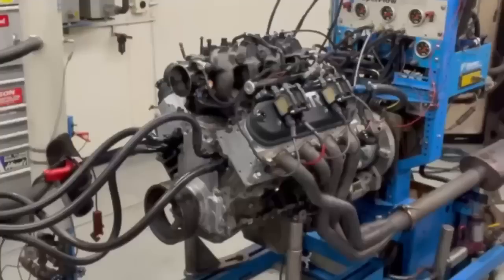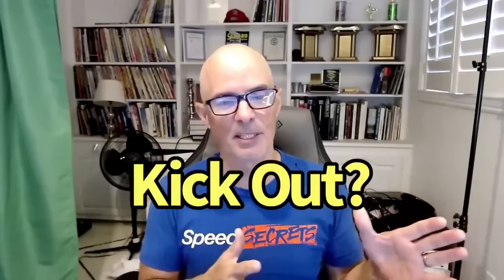When we ran this motor and made 476 horsepower, we ran it with a truck oil pan, which is not ideal — it's what the motor came with. It already has a windage tray, which is definitely beneficial. Two things that would help: one is a better oil pan, something maybe with a kickout; and then maybe a crank scraper integrated into the windage tray — a better kind of windage tray. Getting the oil away from the crankshaft is extra power, and especially if you're creating windage, that's problematic.